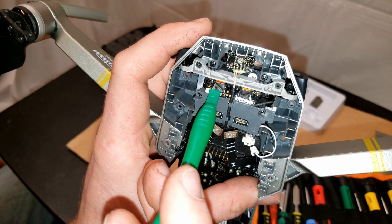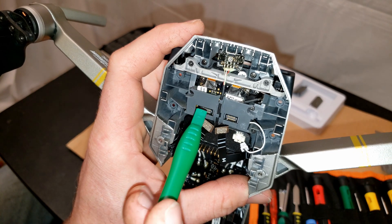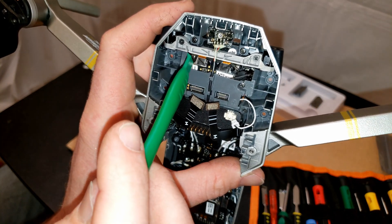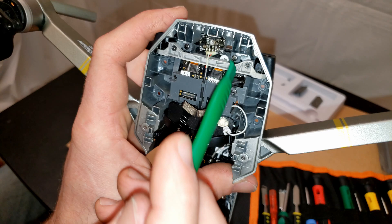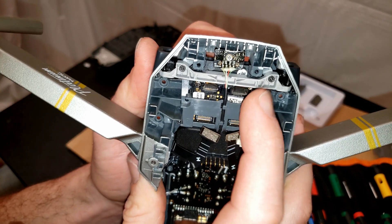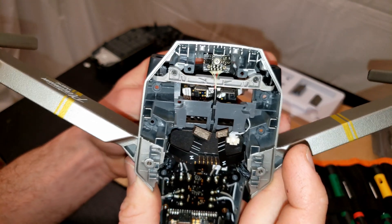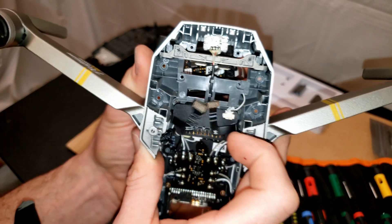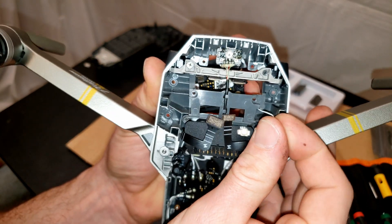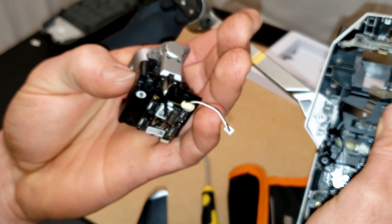These three came right off and these two I just kind of popped up and left them in place since the silicone's there. Now I've removed looks like four Phillips heads holding that gimbal in. Definitely got to pry these front ribbons up the rest of the way, but with those four screws you can now drop your gimbal out. Keep in mind this wire has to fish through right there. That came off pretty easy.